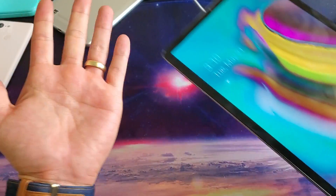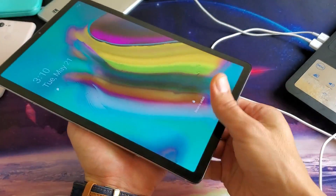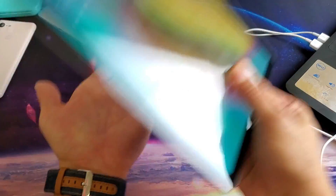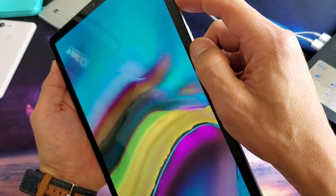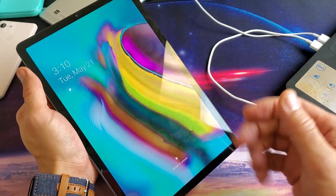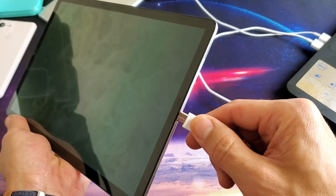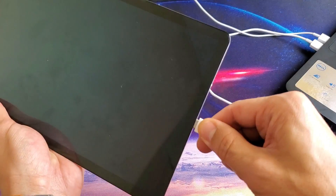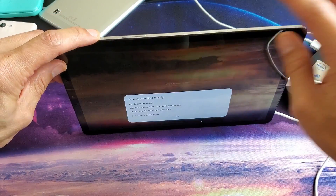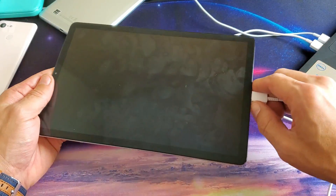Also, go with the back of your hand and tap it — keep doing this for a while. Then grab your tab and press the power button to see if you get a display that comes on. If not, do the same thing with the power. From here, go ahead and plug it back in, let it charge for another 10 minutes, and do the same thing: power button, volume down, press and hold until you see that Samsung Galaxy logo appear.